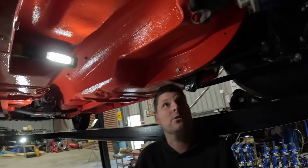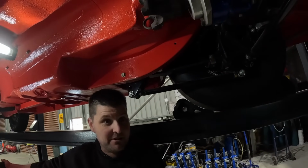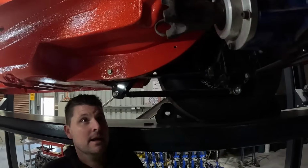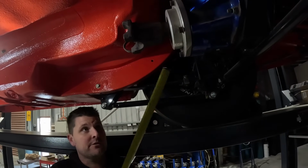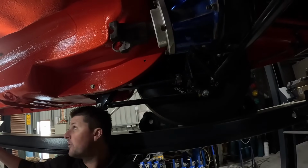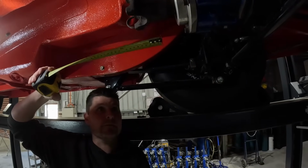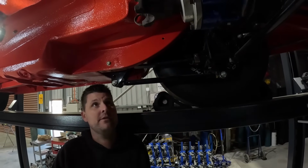The biggest thing when you want to order a shaft, and for instance this car now has got a new engine that could make 1500 horsepower, so it's an old setup. We've just gone to measure it and gone, oh, it's got a small size uni joint on the diff. So that's okay. We can measure it to this diff yoke, but we'll have to remove it. It's built with a solid spacer, so you can do that with a rattle gun on and off. So long as we know our measurement from the trans seal to the center cap on with this yoke, we can then remove this yoke, give me a total length of this yoke, and I can work it out because we know what yoke we're going to put on it with a 1350 rear uni.